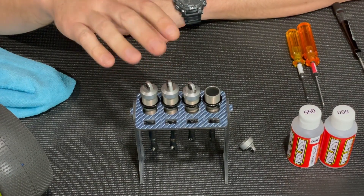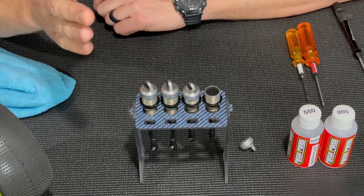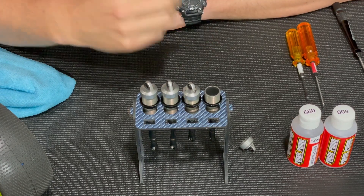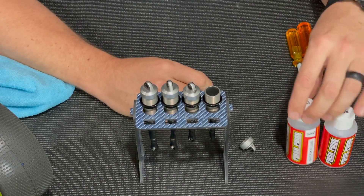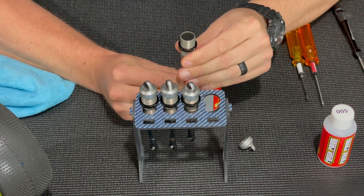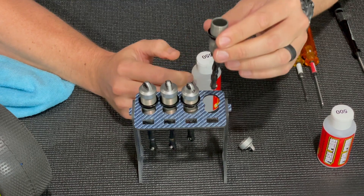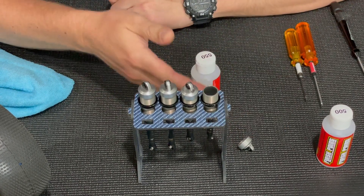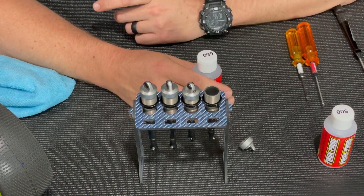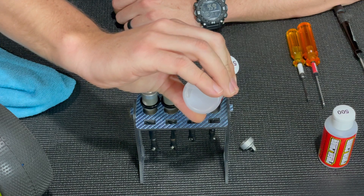These three shocks I've already gone through the method of filling the shocks, pumping the shock, and then letting it sit so that any of the excess air can come to the top and escape from the oil. With this shock I'll go through the whole process. What I like to do is go ahead and fill it pretty much all the way up, then pump the shock a few times to work any air out of the oil, let the air bubbles come to the top, and then let it sit. You can use a shock pump if you're in a hurry or you can just wait it out.